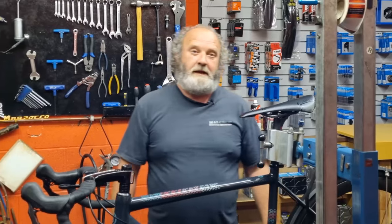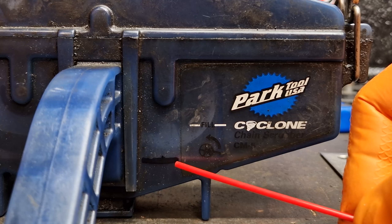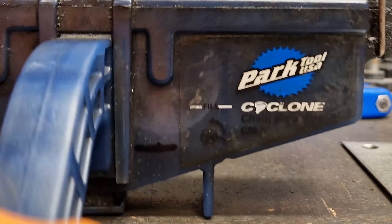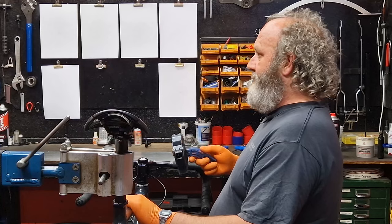That's got all of that off - looking reasonably clean actually. I checked how much GT85 I put in to get the chain wet enough to be cleaned, and I also did the same with some degreaser - they were both the same: 25ml. The line on this chain cleaner is 60ml - that's more than twice as much. So save your money, save the product, and save the environment - don't put as much in as it says on the line.